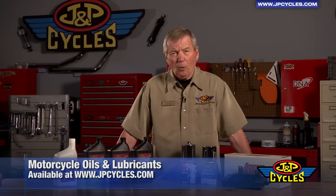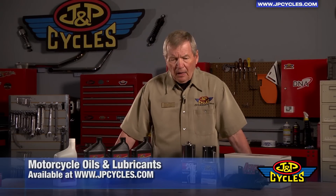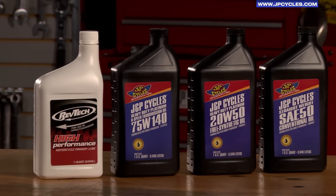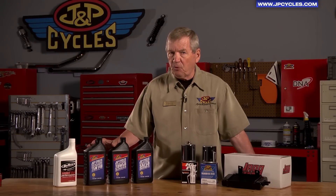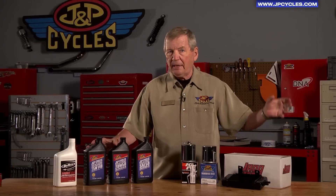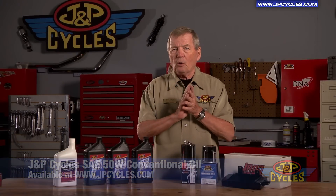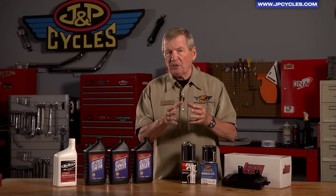The lubricants — motorcycle oil, primary gear case oil, as well as transmission oil. To begin with, it is very important that you know that motorcycle lubricants were designed specifically for motorcycles. And while many people will tell you it's okay to buy car oil and pour it into the crankcase, it's really not. Motorcycle oils were designed for the shear and the cutting that takes place with the lubricant inside a motorcycle engine.